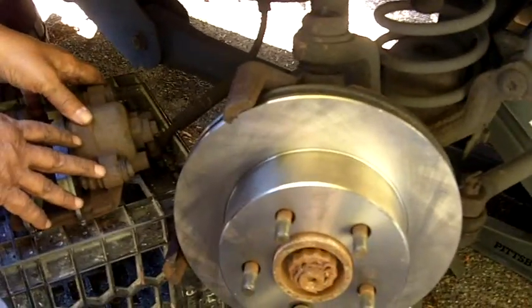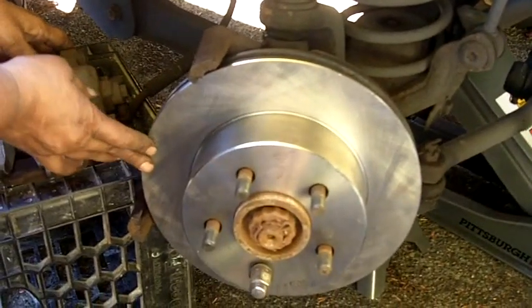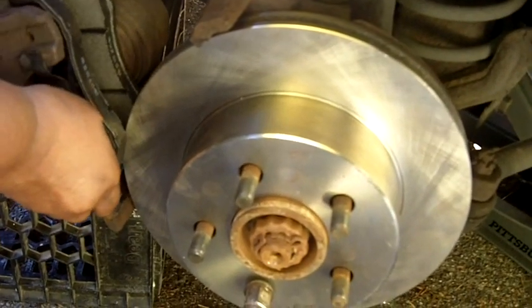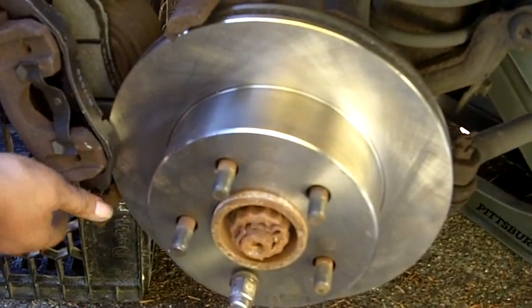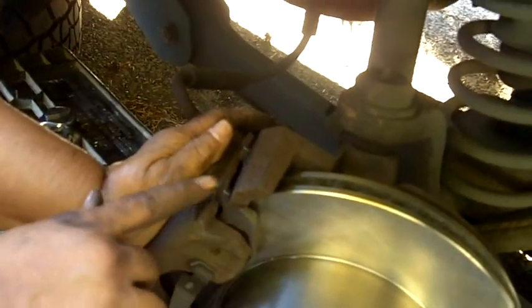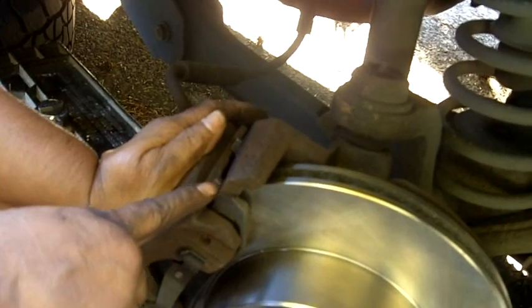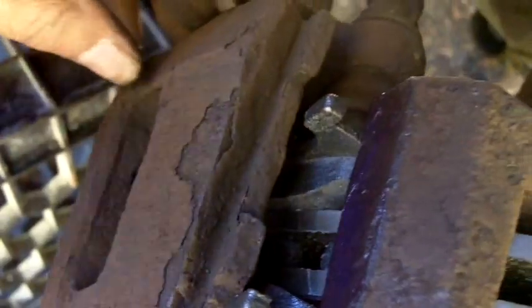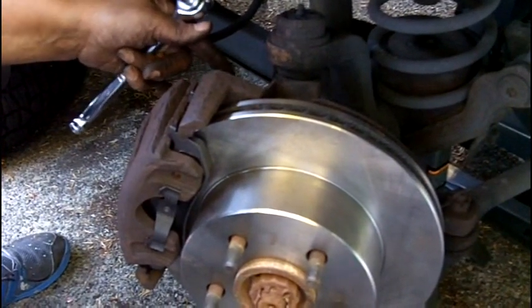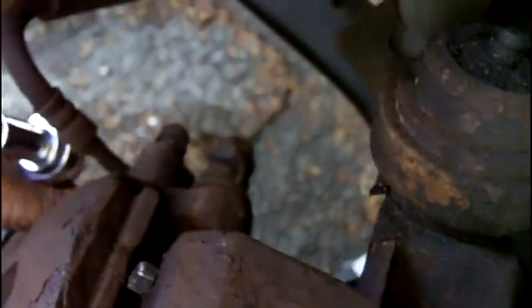Now it's time to put our caliper back on top of our rotor. I'm going to put it in place — you want to make certain it sits right on that notch there. I'm going to push it forward. As you can see, the brake pads are riding the glide — that's the position you want it in. Push forward on the caliper a little bit, give it some pressure, and then start to thread the bolts. Once you have your pins in place, you've got the top bolt and the bottom bolt. Make certain that you don't cross-thread, and then slowly start to tighten them. Lining them up could be a little bit of a challenge.